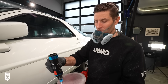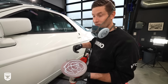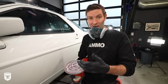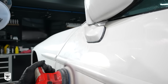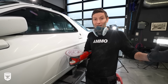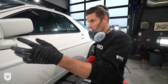Okay, when you apply compound to your pad, this is an exorbitant amount. It's way too much, right, for normal polishing. But in this case, because there's so much residue coming off, it has to be filled somewhere. Obviously, the combination of the pad and the liquid, in this case compound, there has to be enough of that to hold onto it. Sort of like if you were plowing your driveway, the plow can only push so much. So what you need to do is either take smaller bites of the driveway or get a bigger plow. In this case, I put more liquid, so I'm making it a bigger plow so that I can push more residue. Hopefully that makes sense, but we're going along here.